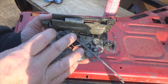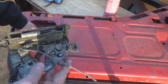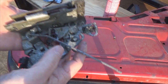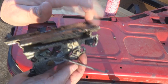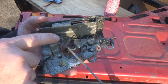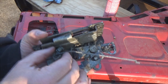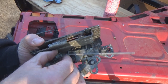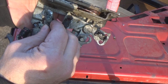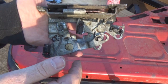In the reassembly process, it goes easier if you do it in steps. This is the rod that went to the lock cylinder - where your outside door lock is. Position it like you see I got it held here. You've got the two bolts up here and one bolt here. Position it like this. Your lock clip - position it upward like that, slide that in, go ahead and lock this one in. You just simply gently squeeze it and it's locked in place.